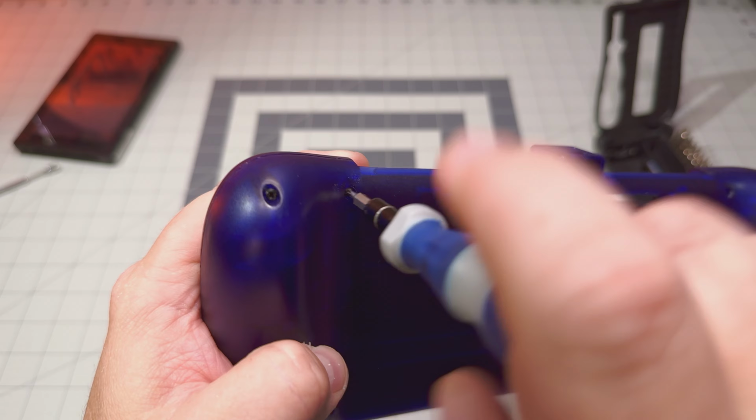And before you put all this back together, go ahead and grab your Switch. Be a little careful. It's not going to be as tight down here, so you're going to have to support this USB-C port down here. Make sure that snaps in. Boot it up. Let's go over to our test now that we have it hooked up.